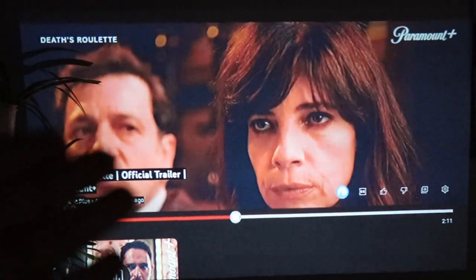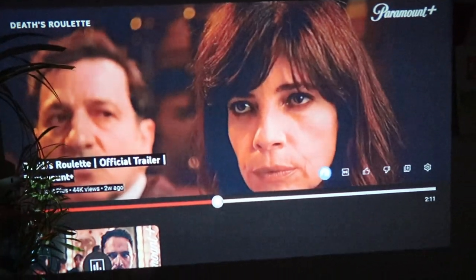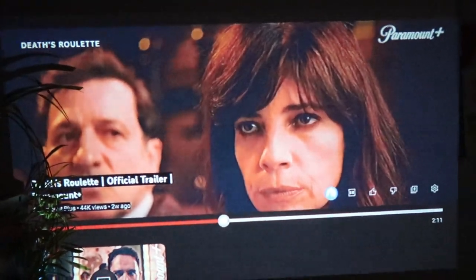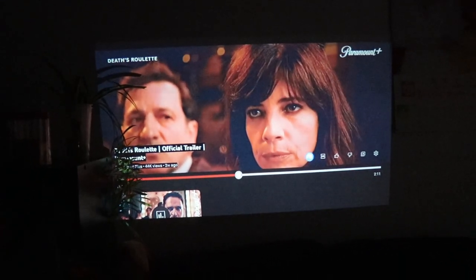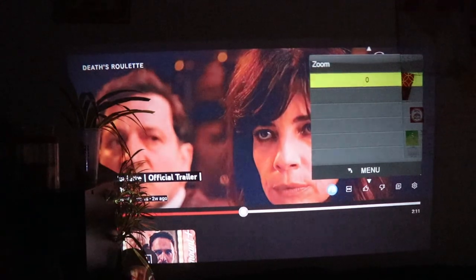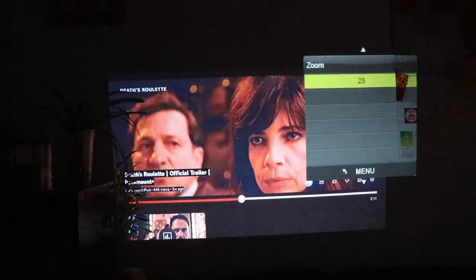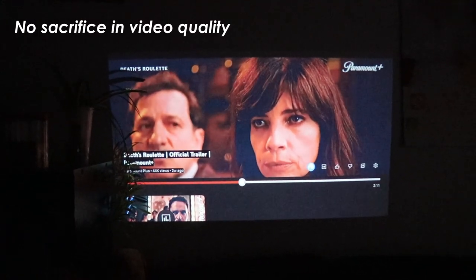As you can see, the video quality of the projector is actually pretty good for a native resolution of 720p. The video may appear to flicker a bit — that's just what I see on the preview camera screen. If you have a smaller wall, you can grab the remote, go to the menu settings, then go down to zoom and adjust it. Setting zoom to zero gives you maximum 100% size, and setting it to 25 makes the screen much smaller to better fit the wall depending on your room size.